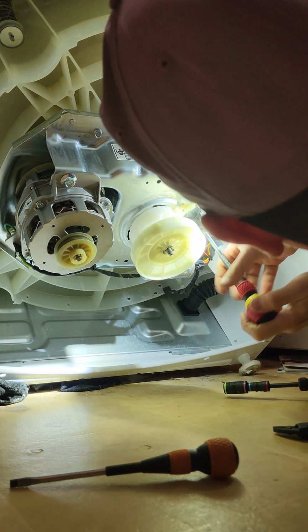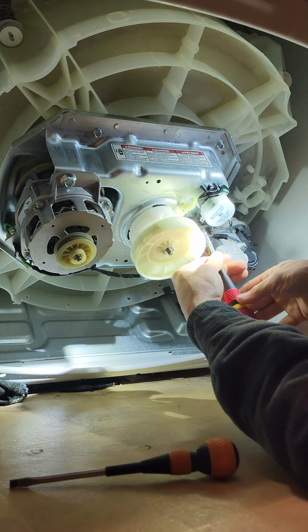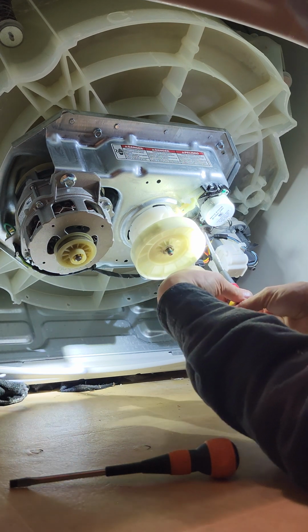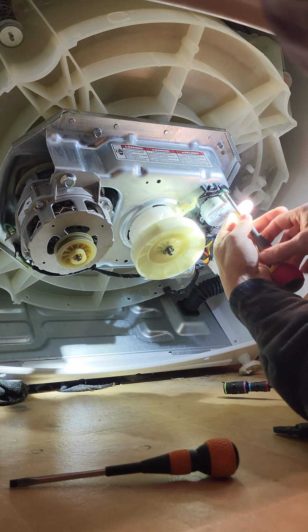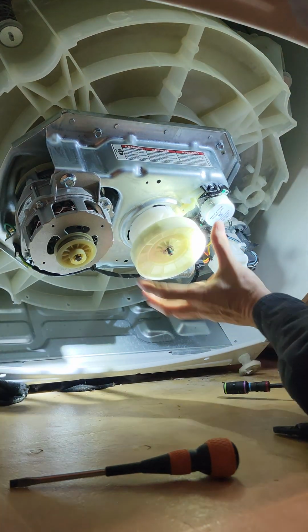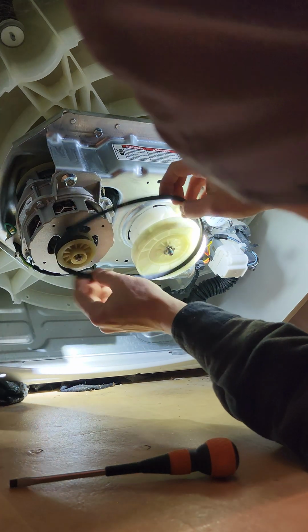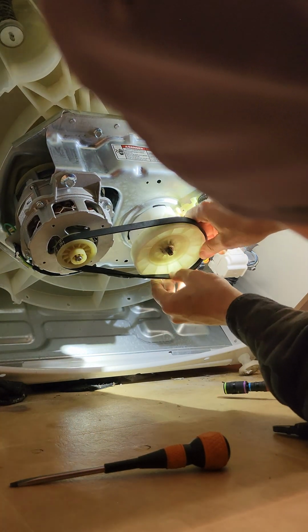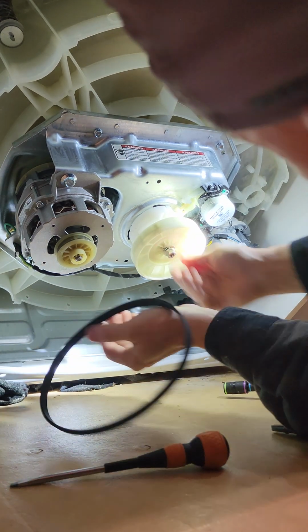But there's a way in the service menu, which, yep, our tech sheet's up there. We can snag that out, and there's a way to resynchronize this so that it knows what mode it's in if we have to, but usually you don't, from what I've seen. If it gets confused, basically, it'll recalibrate. We put it back where it was, so it should remember. Okay, now this one, like I said, has grooves on it. Usually the front pulley's never the culprit. We're going to put this on, and then we'll tighten our pulley on here first, just in case. It shouldn't move, but you never know.